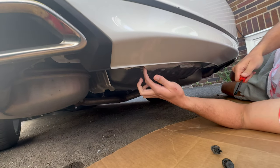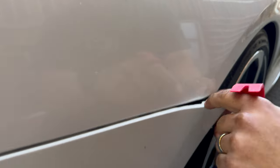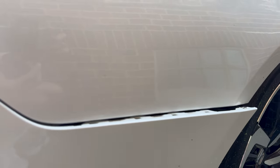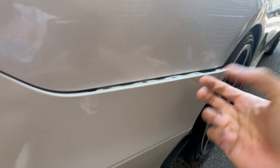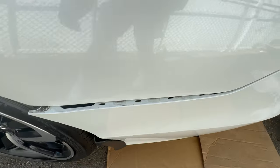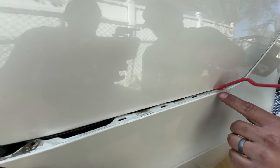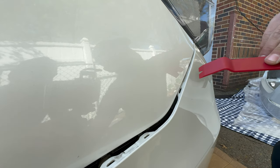We could do the rest of the plastic trimming — we'd rather do it afterwards once the bumper's off, because we didn't jack up the car and we're on the floor. Alright so we're gonna use the pry tool to pop it open. You can either use the tool to poke the little holes that it has — the clips — and move it out, or you can just pull it a little bit and it'll come off. We did the same thing to the other side already. On those little holes there are little tabs, and you just push down with the pry tool and it should come off easily.